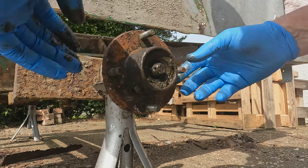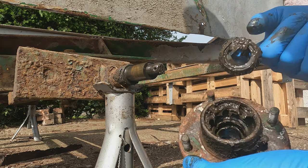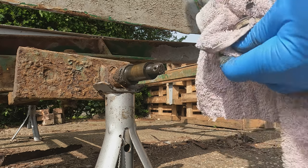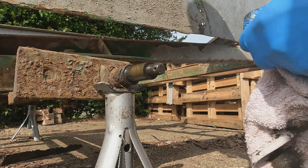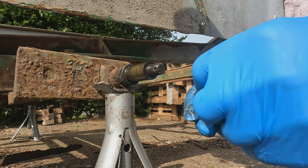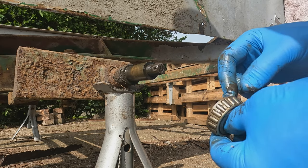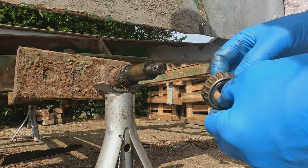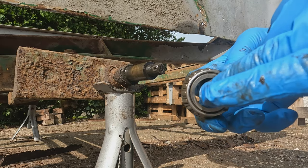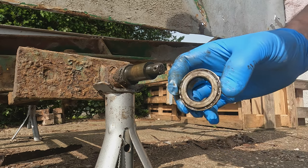Now we've got to take it apart — it just fell off on its own. So there'll be a couple of bearings in here. There's the first one, and the problem is if you look at the colour of the grease it's brown and quite oily, not as thick as it should be — that's because water's got into it. Give that a quick clean off, and with even a quick clean you can see there's actually not too much play in that — it's fine. If it was no good you'd see the outer bit fall off and all the bearings fall out too. If you need to order one of these, you can measure it or look for the numbers in the middle and search for that to find the bearings.